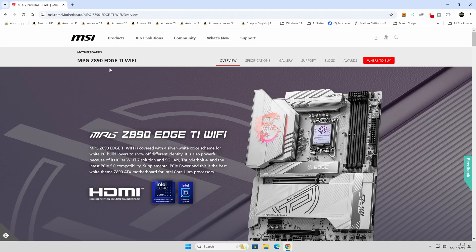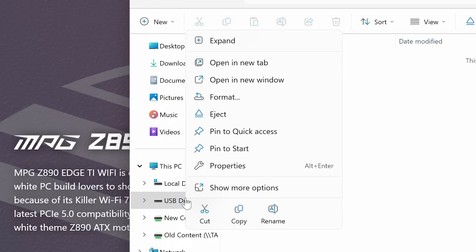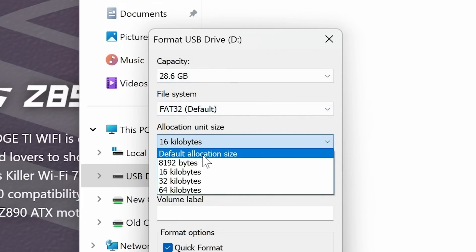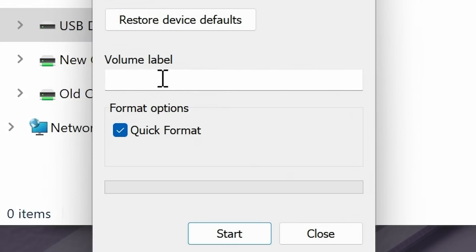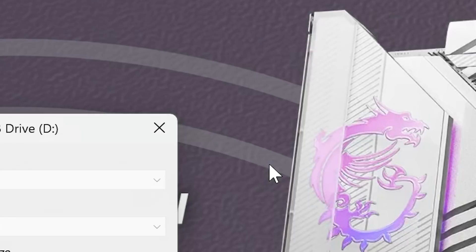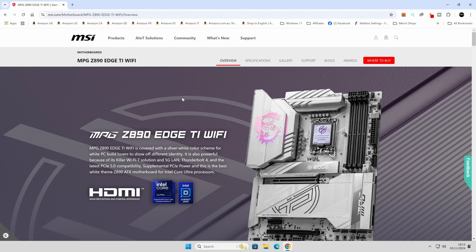So we're on our Windows machine. I'm going to put the USB drive into the computer — it's blank, but it's best to erase it anyway. Make sure you've backed up any data you need. Click on Format, make sure it's FAT32. The allocation size you can set to default. If there's a volume label, make sure to remove that. Once you're ready, click Start. You'll get a warning that it's going to erase all the information on the disk — click OK. Once done, it'll say Format Complete.